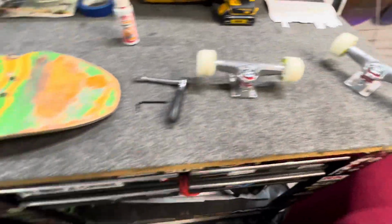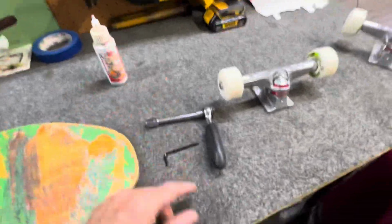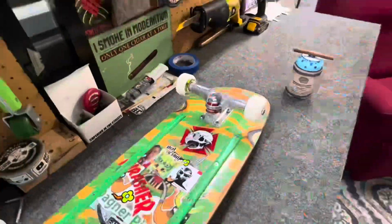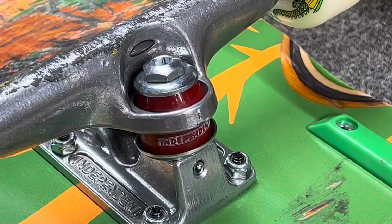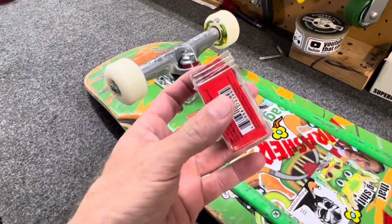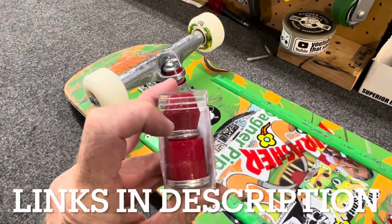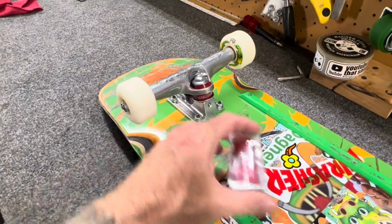All right, we're gonna bolt these on and we'll adjust them. And then we'll blue Loctite the set screws. We're ready to grind. Pin install is completed. Now, if you'd like to do this at home on your own, you're only going to achieve this by purchasing a set of Stage 11 standard bushings. I get the red softs, and you're gonna change the Stage 4 top bushing for the Stage 11 top bushing. It's going to lower it.